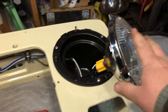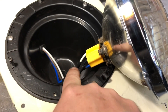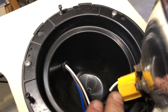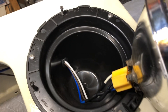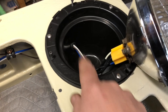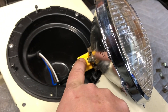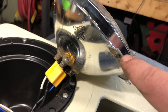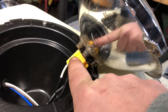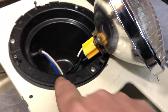Before putting the headlight in, here's our connector — everything shrink-wrapped with shrink tape pushed onto the connector. Don't forget when you put this wire through to put the rubber seal that goes inside. I forgot so I had to slice it and stick it in, and I'm going to put a little silicone around it on the outside so no water gets in. I put dielectric grease on here, and thick tractor grease on the mounts. The little tabs fit in there and hold tight.